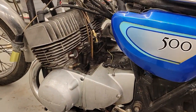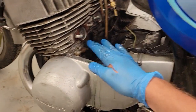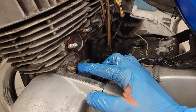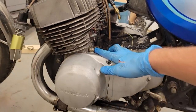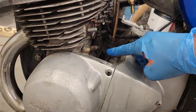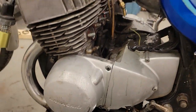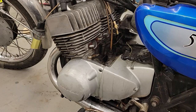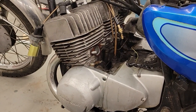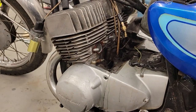Although this is a very reliable oil injection system, these check valves do have the potential to fail. When that happens, the oil tank gravity feeds through the pump, through the lines, through the valve, and fills up your lower cases with oil. Then you go to start your bike and you've got a hydro-lock situation where you can bend connecting rods, puncture holes through cases — basically you blow up your motor.